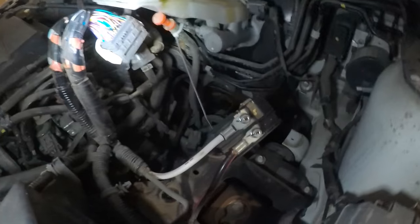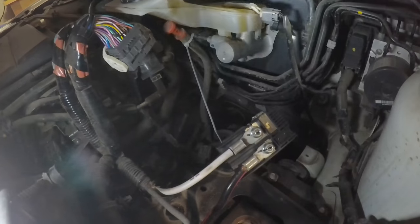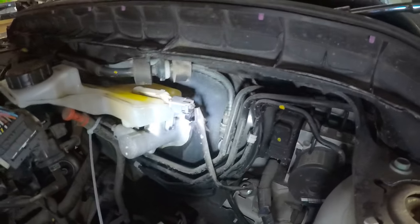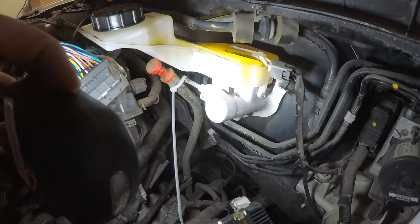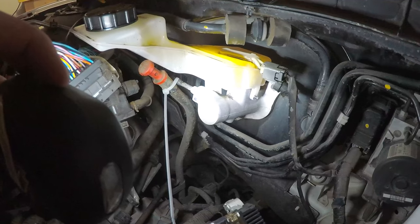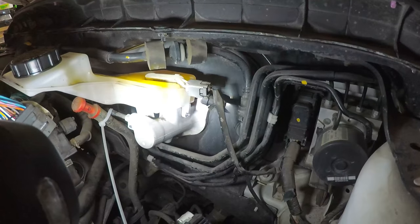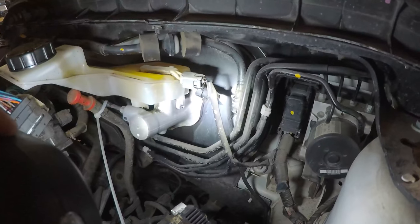Once you've got it out and the ECU — which is connected to these cables here — it's not too bad. Then you're going to have to disconnect the brake from inside. I zap-strapped the master cylinder to the transmission fill just to pull it up out of the way, so there's not too much strain on it. That worked for me since I'm only one person.